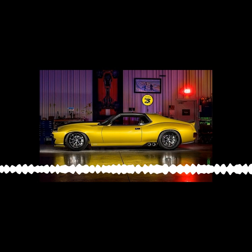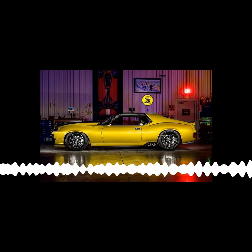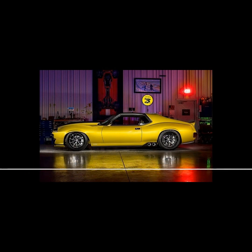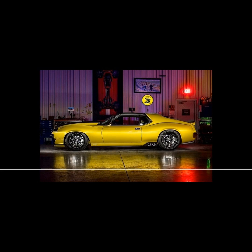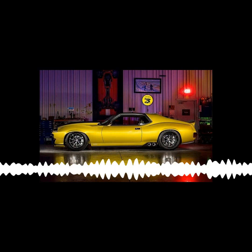So you're laying it up, and we're only exposing the roof on this car, the taillight panel, the hood, and the front chin spoiler. The carbon goes in the mold dry, meaning you spray glue basically to hold the carbon in place in a mold, because you want it to line up and you don't want it wavy or anything. It's got to be super straight.